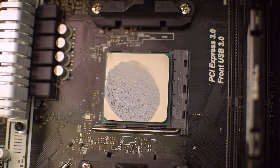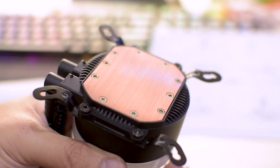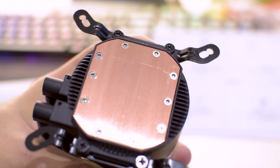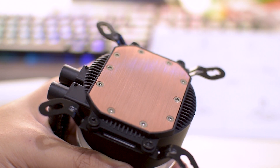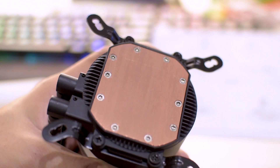But if that was really the issue, it may have worked fine on an Intel-based system. So I tested it on an Intel Core i7-4930K and noticed very similar things — even without stressing the CPU, it was sitting at idle at about 55 Celsius, peaking at 62 Celsius on idle. I also noticed that the cold plate was much more coarse than usual; I'm used to manufacturers giving close to a mirror finish, but it's highly unlikely that's totally the culprit — it sucks, but it's not like 20 degrees of suck.